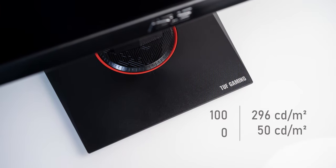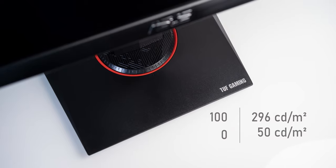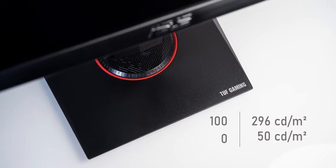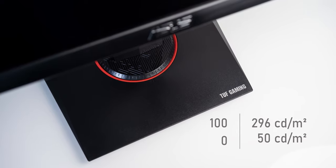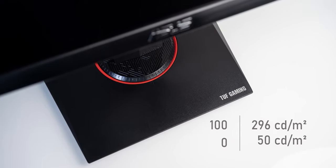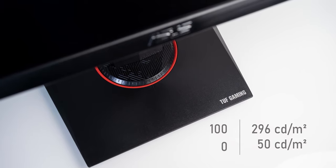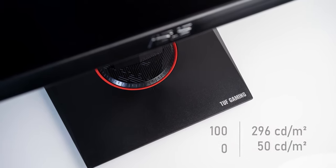Now let's take a closer look at the panel's performance — literally starting with a close look at the panel. We can see the subpixel structure and the anti-reflective coating. Text is rendered clear, so everything is as it should be. Turning the brightness all the way up to 100% leads to a peak luminance of nearly 300 candelas per square meter, which is a good bit more than the 250 candelas from the spec sheet. Turning the brightness all the way down gives 50 candelas per square meter, which is a good value for using the monitor in a darkened room.